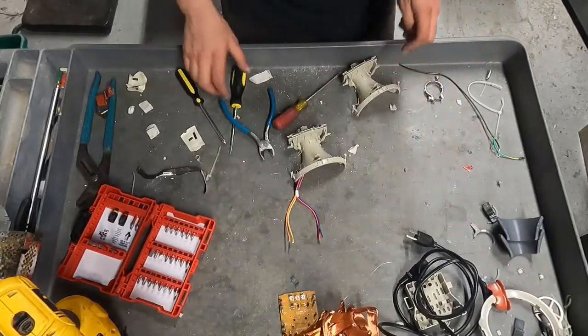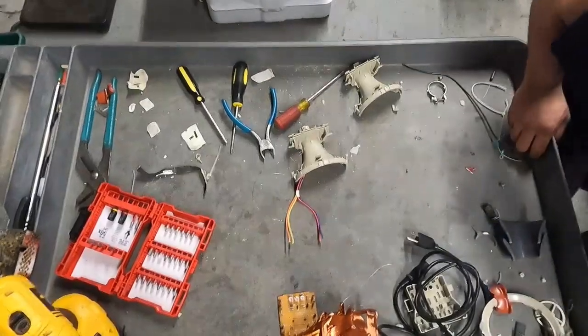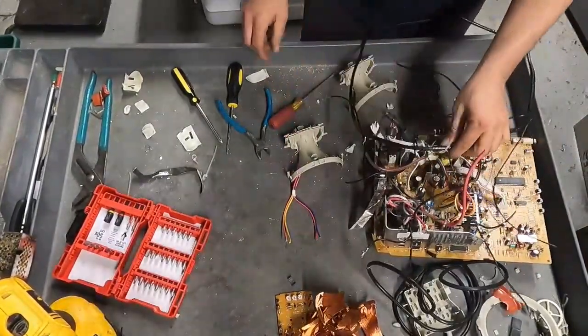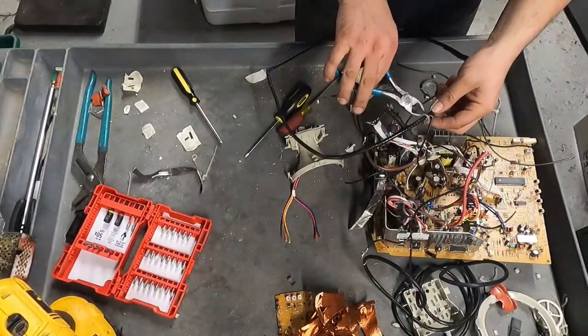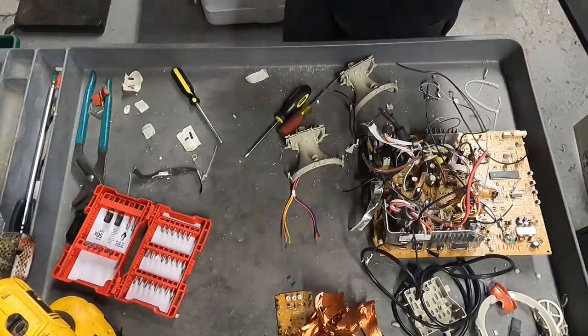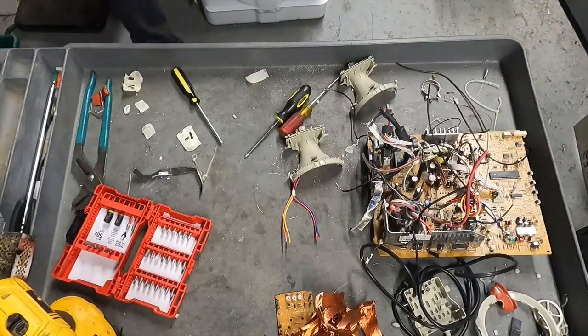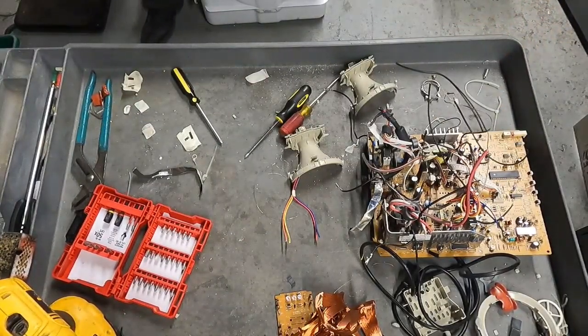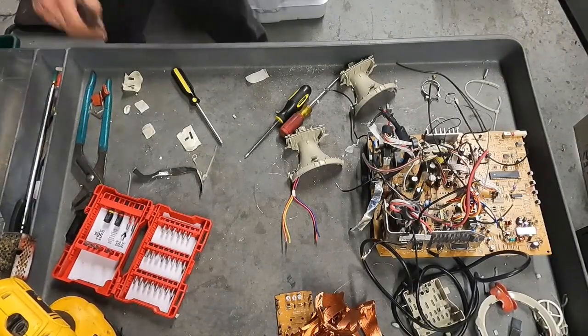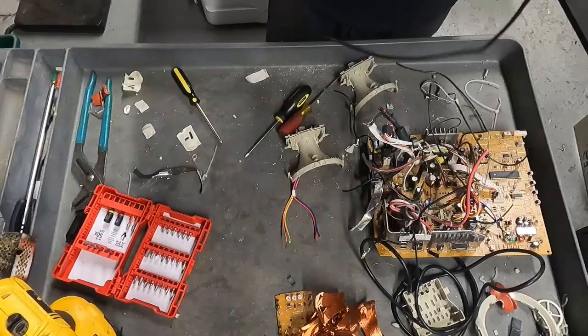And then, let's see, the degaussing cable. It's this cable right here. One thing I would recommend you do first, besides clip off every little piece of junk that you can find on it: this is all electrical tape. This does not get stripped inside the stripping machine. It actually gunks up the rollers, and then I literally clean the whole machine. So you don't want to use something that has an adhesive to it.